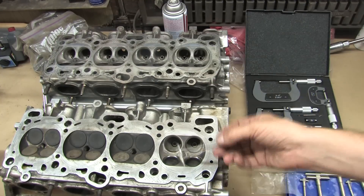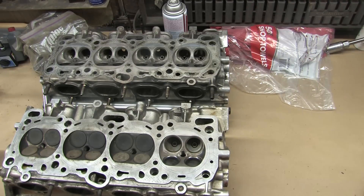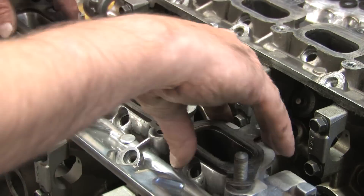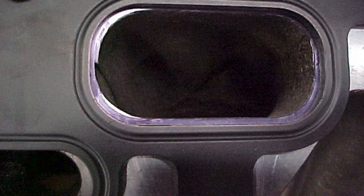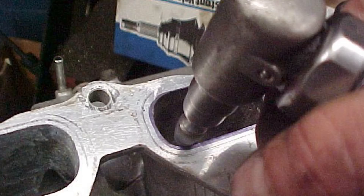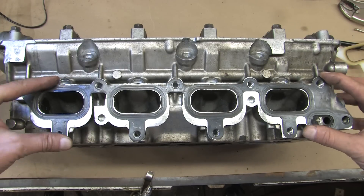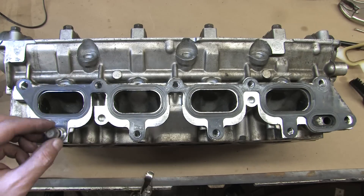Here's the seat measurement of the ported head. You can see how much has been removed in the boring and porting process at the edge of the seat. The measurements that matter would be deeper in the runners and at different angles across the port. So that's another illustration of how to keep tabs on your progress — you're not digging a hole to China, you're peeling an apple. When I still had a 2G intake manifold on this head, I gave both mating surfaces this same gasket matching treatment and only blended it about 3/4 of an inch into each part. That's all you want to do.